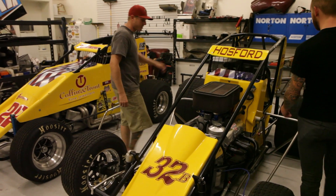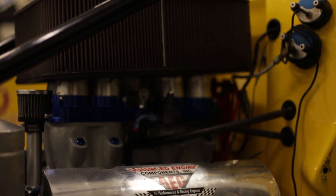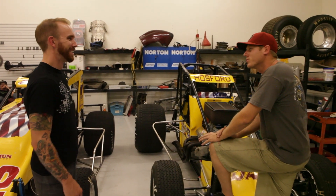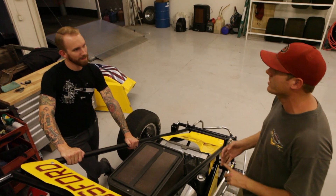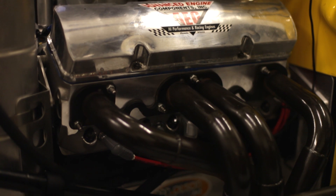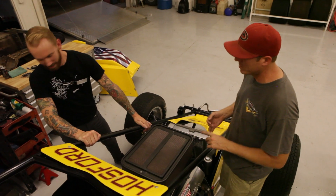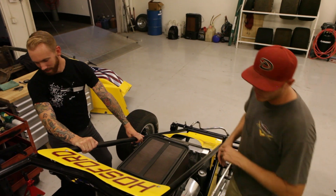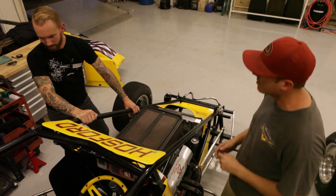So here it is, Chris. This is our 360 sprint car. We run on dirt with the USAC 360 division. Pretty similar to things you're familiar with. This thing's got roughly 700 horsepower, and a weight ratio with the driver of 1,450 pounds — a little bit more aggressive than what you drifters might be used to. That's like 1,200 pounds less than us, but some of the same concepts. We use methanol to fuel this bad boy. It's pretty simple though — there's no battery, no alternator, you don't turn a key to start this thing, no transmission, no shifter. That's how these things get so light — they cut off all that extra fat. The fuel pump and power steering pump simply run off the backside of the camshaft. Direct drive. The drive shaft runs out of a yoke out of the back of the motor into the rear end where there's one drive gear. You simply put this thing in one gear, get a bump start from an old 1985 Bronco, and you're gone.